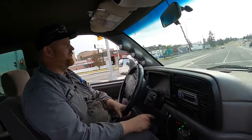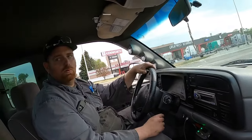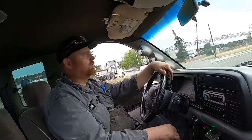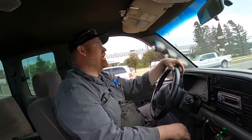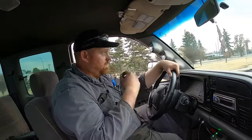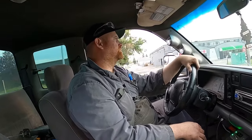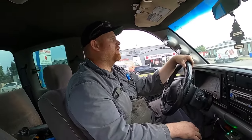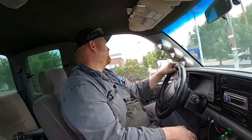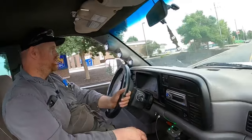Didn't peg the gauge at 1500. Yeah. And I don't have the water meth on. The water meth's off. Right? And it didn't peg 1500. Definitely getting better then. So either I needed to drive that turbo even harder than I was driving it, or something's funky. Because I shouldn't be down in power and lower EGTs without water meth. I should be higher EGTs. Well, the only other way to test that other turbo is to put it on my truck.